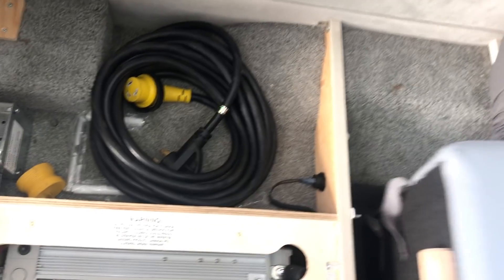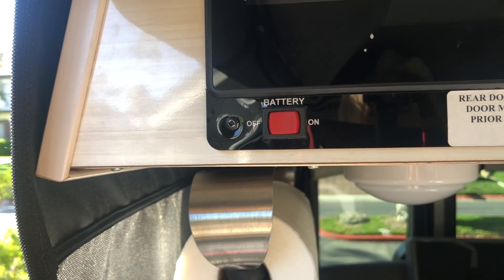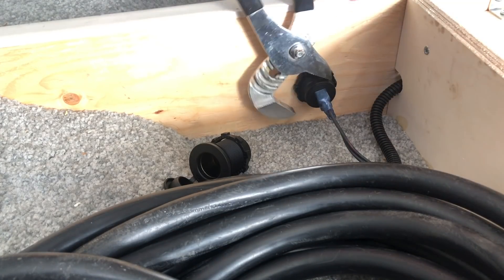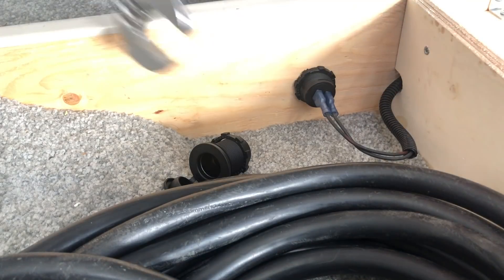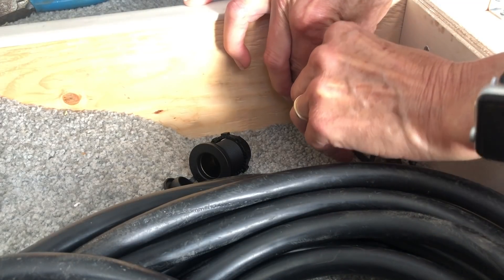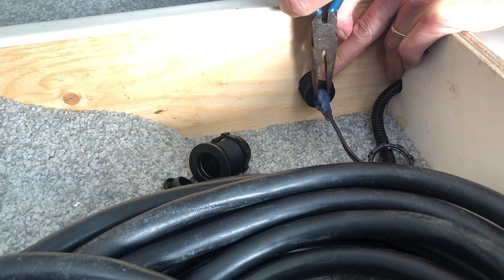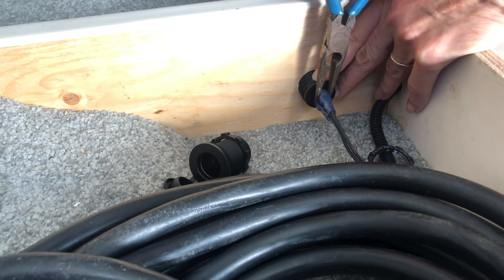In the case of our van, you just flip up the ottoman and there is the plug. Be sure to turn off the battery first. The only tools I used for the project were a crescent wrench and a pair of needle nose pliers. It just takes a couple of turns to loosen up that tightening nut on the back of the socket, and then you can just by hand remove it very easily. Then grab the needle nose pliers and pull the wires out. You don't want to grab the wire itself because you'll pull it right out of its casing. This one was a little harder than I thought to pull out — it's in there pretty tightly — so I just kept wiggling it until it came free.